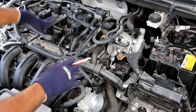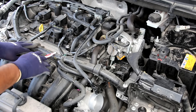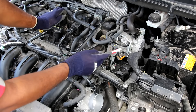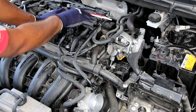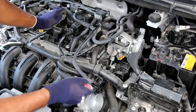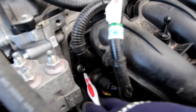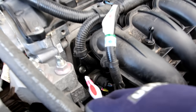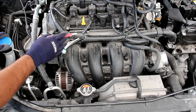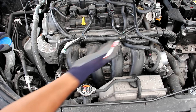Taking a look at the fuel system on the CX-5 — this is a direct injection engine only. There is no port injection, otherwise you would have port injectors at the top here. The low pressure pump in the tank brings fuel to this high pressure fuel pump. This high pressure fuel pump is actually driven off of the exhaust camshaft, pressurizing the fuel to a really high pressure and sending it down the fuel line underneath this intake plenum so it gets directly injected into the cylinder. The fuel rail runs the length here and has four individual injectors. Now because this engine is only direct injection and there's no port injection to clean the intake valves, at some point you might have to remove this in order to clean those valves manually because you could have carbon buildup causing an issue.